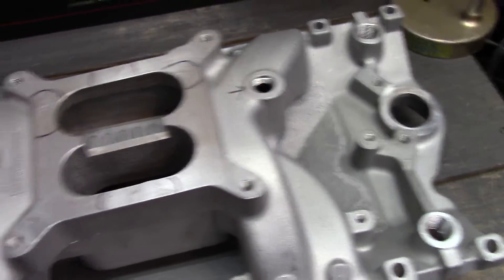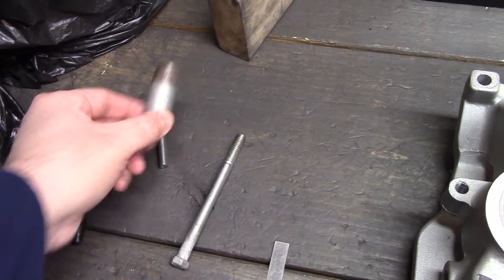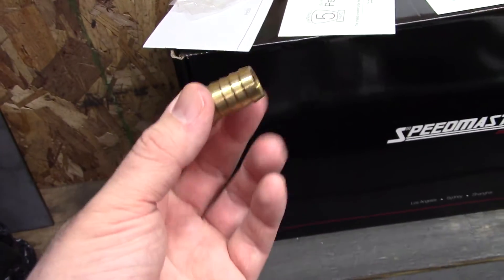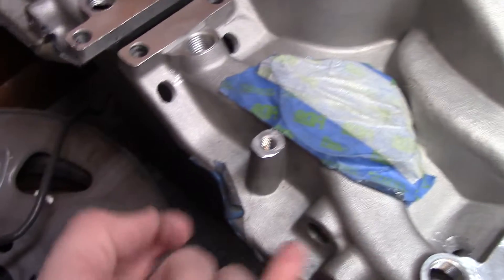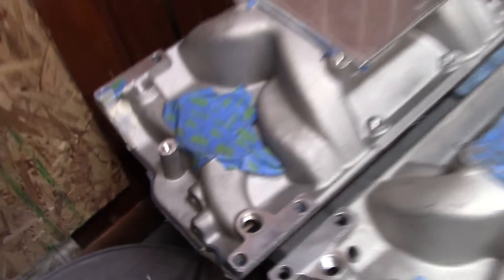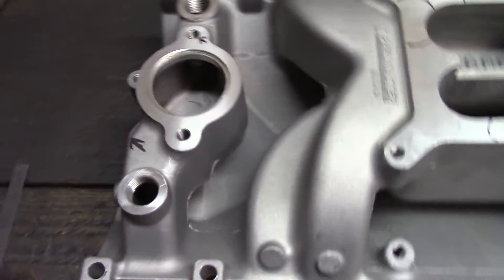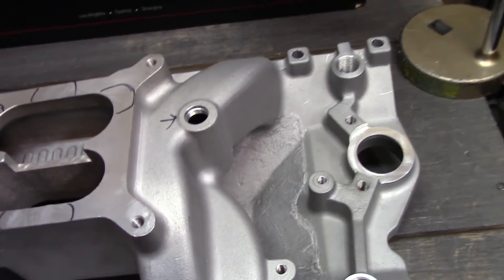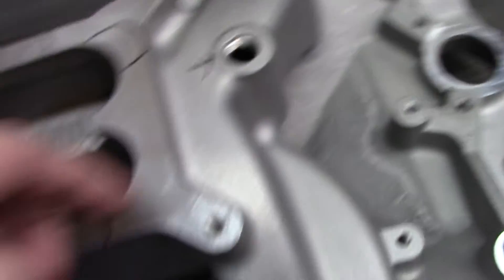That's the first very obvious problem. Moving on, the next issue: I went ahead and checked all the threads — 5/16ths, 3/8ths, and half-inch NPT. It comes with this 3/8ths NPT nipple, which I'm assuming is for the Vortec front through-hole, since the only other Vortec intakes I have also have that same feature. I checked all the threads and all check out but one. I cannot start a bolt in one thread because it is messed up right at the top, so I have to run a tap in there to fix it.